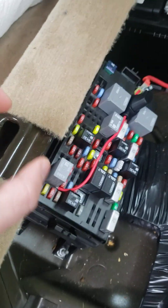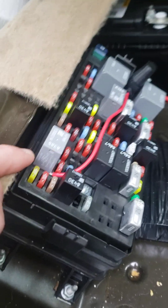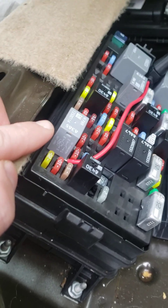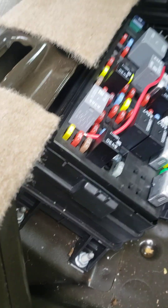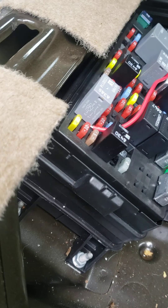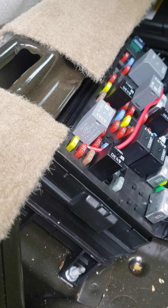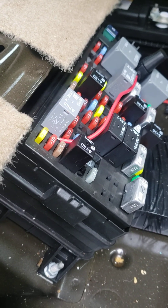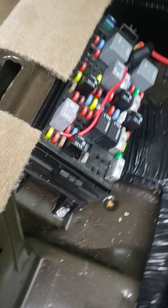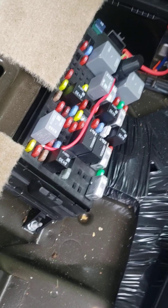In a pinch you can pull that out and do a direct jumper. If you want to diagnose it, you can check the amperage flowing through that jumper — you should be seeing somewhere in the range of about eight to nine and a half amps traveling through to the fuel pump. That's how you can confirm the fuel pump is functioning correctly. I'd encourage you to do that because they're not cheap — the cheapest one I found on Amazon was about $85, but an OEM fuel pump is three to four hundred dollars, so diagnose it first.